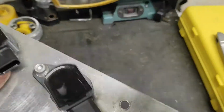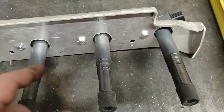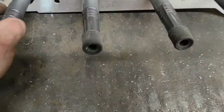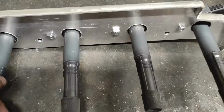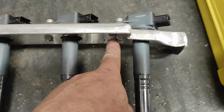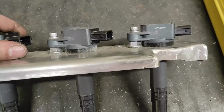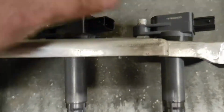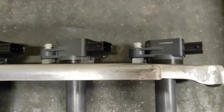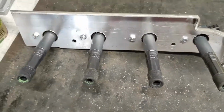Okay, so that's that off. Now the main thing I'm looking to fix is the fact that it's nuts and bolts on the bottom. So obviously I have to take it all off in one go to get on that. If I just undo the top bit, the nut's going to fall off. I could weld a little nut on the bottom, but what I'm probably just going to do is take it out and put a riv nut in here, so the top can just screw on together. I'm fine with using the nuts as spacers, because they give the perfect height. So hopefully that should be a quick, easy fix for this.